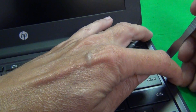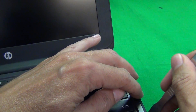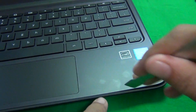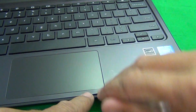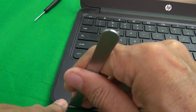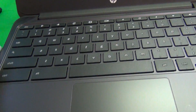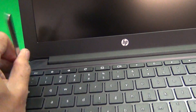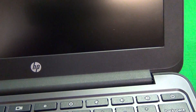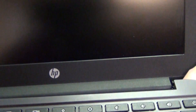Work in between the rubber sides and the gap in the keyboard assembly, and just work around the keyboard to pry it open. You'll hear some snapping sounds. You might have to go around several times before it's totally detached from the bottom assembly. Go around the keyboard assembly — there's a place at the top too, so you have to pry it open there as well.